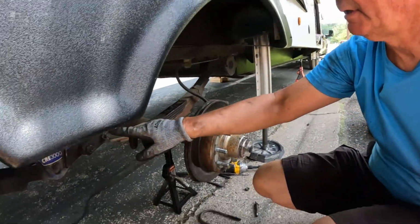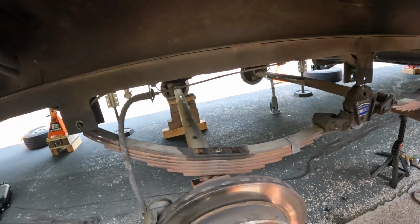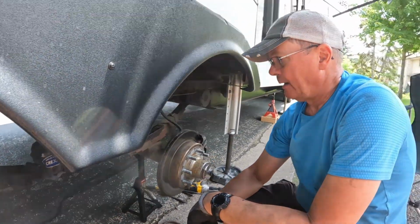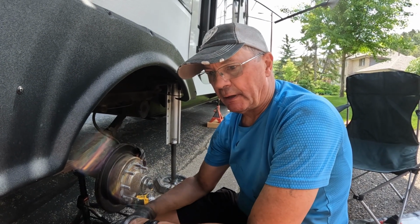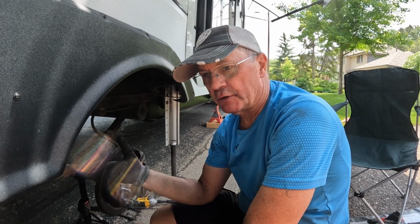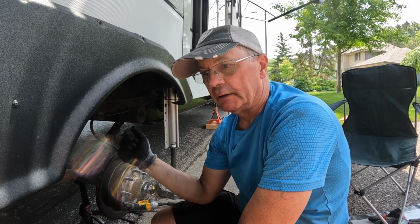Yeah. Demolished. Right. So one of the big pluses about the Roadmaster is, one, it greatly reduces the number of maintenance points on the suspension. But this has got wet bolts here, here, there, and over there. The new slipper springs would really only have 2 points that you could grease. And that's dependent upon whether you use the nylon bushing that they have in the springs. We'll show that later. If you use that nylon bushing, you don't have to grease it at all.